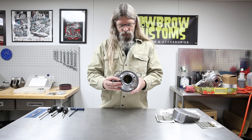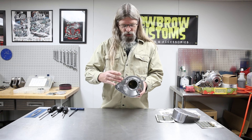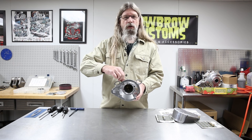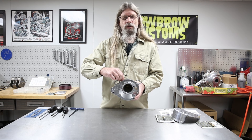On a stock plate there is a lever attached to this hole right here — the screw right here — that controls your enrichment circuit. This is not a choke. It basically adds more fuel for startup.